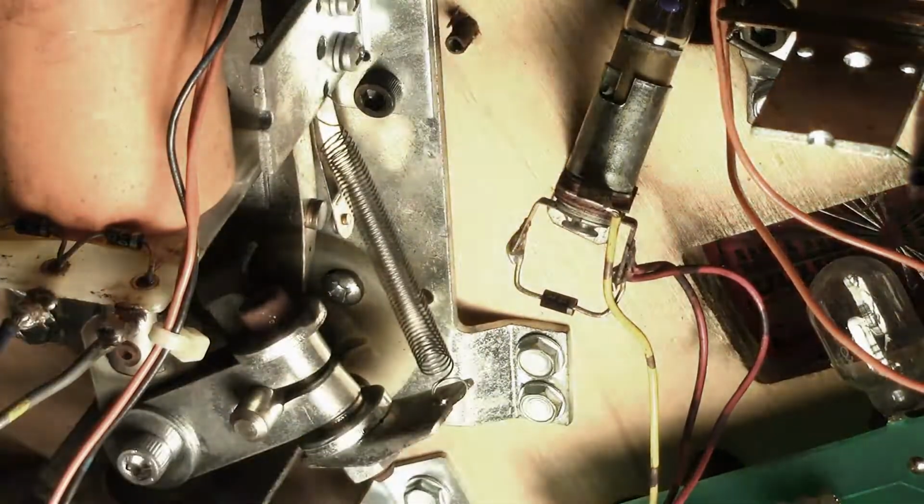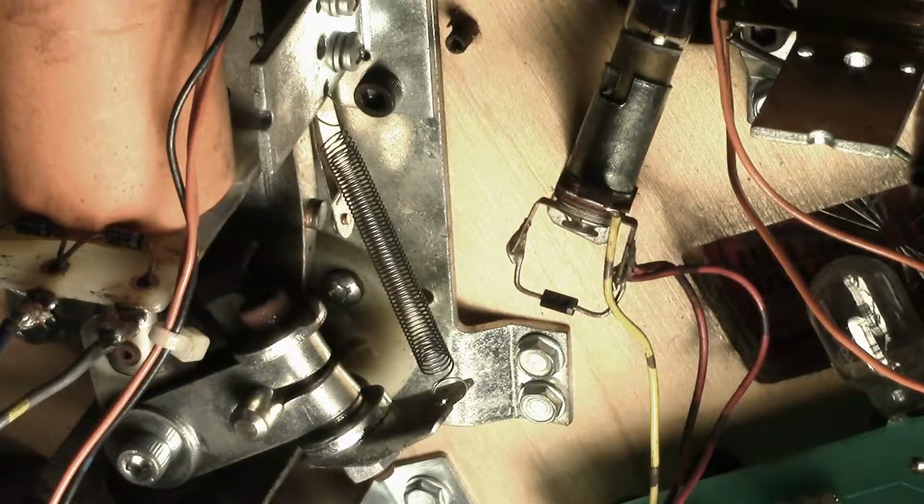Now, on a pinball machine, you have basically two types of contacts. You have a high voltage contact, especially on the old electromechanical machines, where everything is brute force with coils and higher voltage. They actually spark and arc, and you have to use a file or sandpaper on them, because the contacts are hard tungsten, which can stand the high heat.